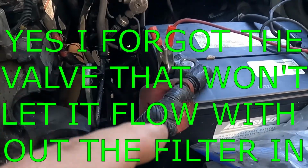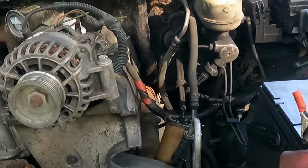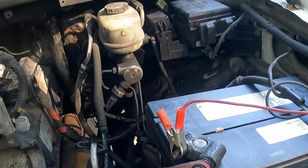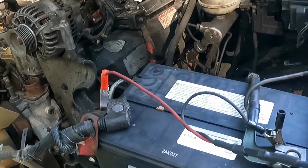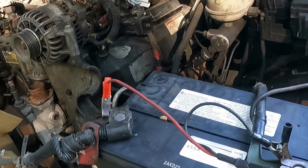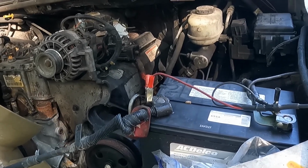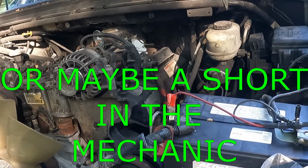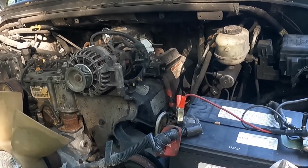So we got one battery hooked up and we got our power probe hooked up to that same battery. So that way we can check out and see if maybe we can power the fuel pump. Like this is my own video and I can't even figure out what the hell I'm trying to say. So we can send power to the fuel pump and kick it on and see what's happening, you know, see if we can make it pee. So either we got a bad fuel pump, bad electrical, or not enough fuel in the tank, which we should have enough for it to pick up, provided the pickup in the tank hadn't fallen off, which is common. And you've seen some other videos of mine on that. So let's get under there and see what we can make happen.